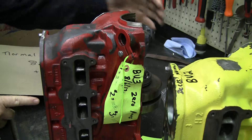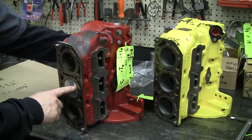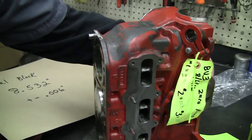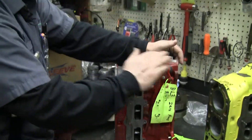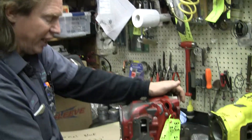The other thing you'll notice: the pistons are normally proud of the block just slightly. On this one with a standard piston in it now, with it decked like it is, you can see how much that piston pops out. If someone's decked a block and you try to use it with standard pistons, you're going to have a big problem with interference on the head.